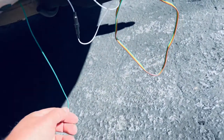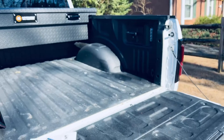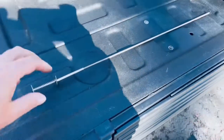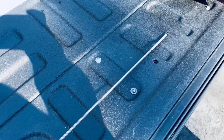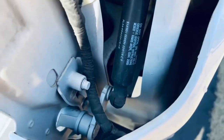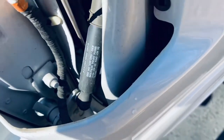I've run the green wire from the MC Tuning back down and we're going over to the passenger side turn signal to tap in there. That'll be the only connection on that side — everything else is connected on the driver's side. A great tool for fishing wire is what we call a crow's foot — you push the little button and it comes out like a crow's foot then retracts. It's one of the best tools for fishing wire through tight spaces.